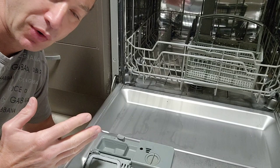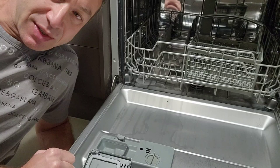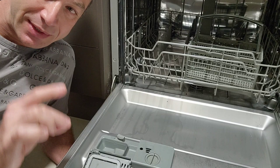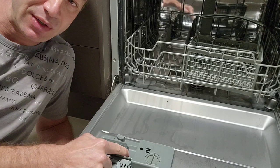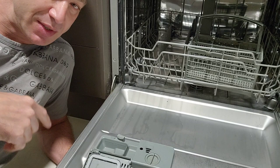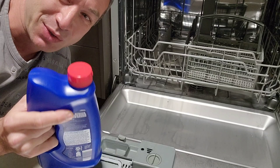There's a huge war going on between tablets — which one is better. I like Finish, I like Fairy, I like other tablets. Yes, it does matter what they put in the tablet, and one tablet is definitely better than another. But it doesn't matter which tablet you're using if you're using a tablet for your dishwashing, because when you put a tablet in the main compartment, there's nothing going into the pre-rinse. The magic solution — are you ready? Old-fashioned dishwashing powder.